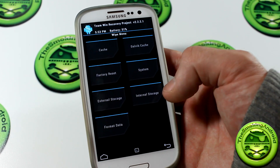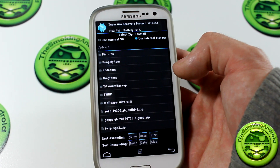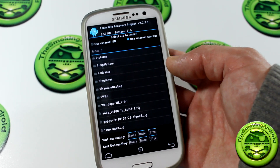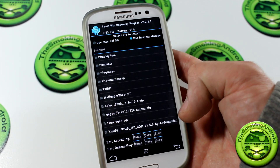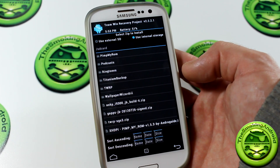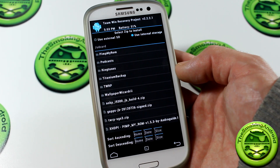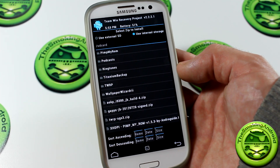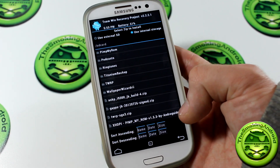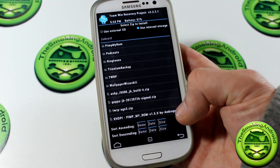So now that you've got a fresh slate here, we're going to go ahead and click Back. We're going to go to Install. I actually have this on my external storage, even though you'll notice it says internal storage — that's another story for another day. You'll notice we'll go down here to the bottom, and the file that I've chosen — because you do have to choose a file compatible with whatever display you're using — and this is an Aroma Installer file. So you'll notice we have XHDPI selected for my Samsung Galaxy S3.